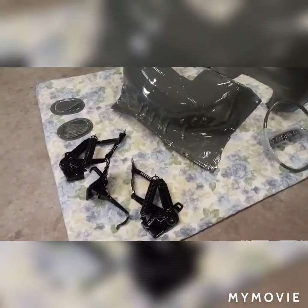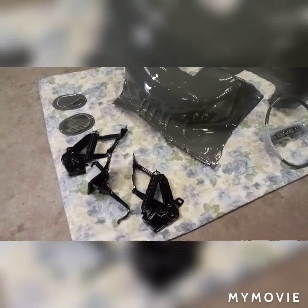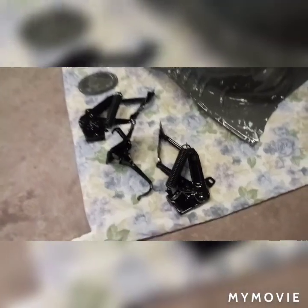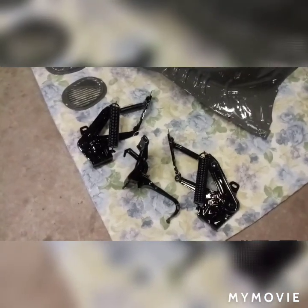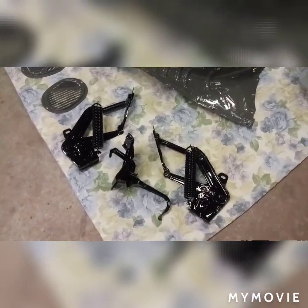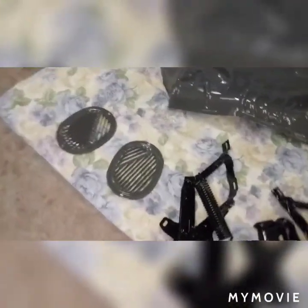August 9th, 2020, and I just want to do a little video here to document the work that's been done over the past few days here. We got the hood hinges and the hood striker in gloss black. They had been previously sandblasted and primered, so we just scuffed it and then sealed it with epoxy and then black base and 2 coats of that SPI production.